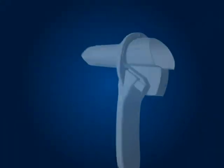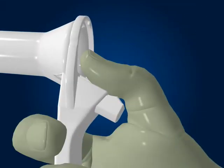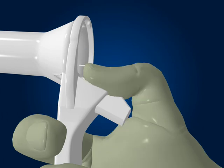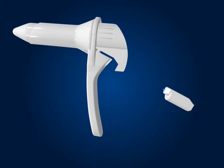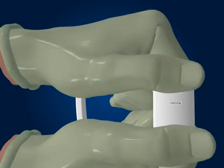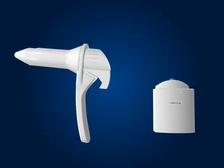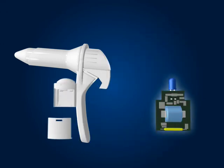The light capsule can be removed from the device by firmly grasping the capsule with your thumb and sliding it back out of the capsule holder. The light source has been designed so that the circuit board and battery can be separated from the plastic parts. Grasp the capsule firmly in both hands with both thumbs either side of the join on the curved side. Pressing firmly, snap the capsule at the join and remove the circuit board, battery and light.